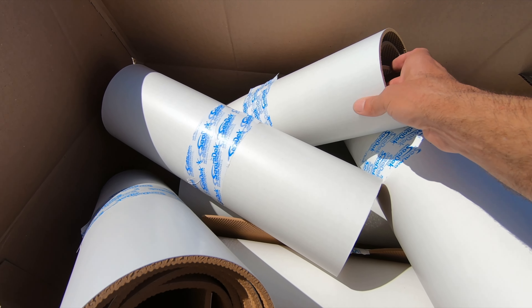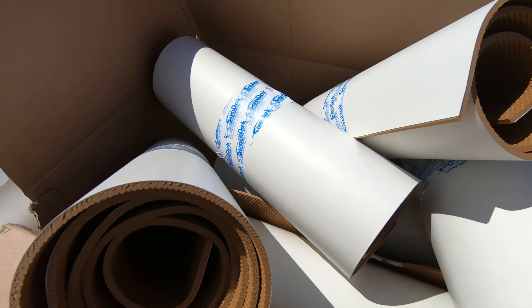The sea deck comes in rolls — I get it from packaging — which means they all need to be unrolled and laid out flat, because you can't pattern them when they're trying to roll up on you. This material is something I was looking at months ago for a non-slip deck upgrade option, but at the time the total cost would have been upwards of $600. However, the manufacturer recently ran a 50% off clearing sale. I'm giving the washed surface a final wipe down with acetone to ensure good adhesion.